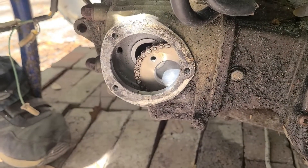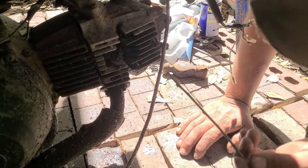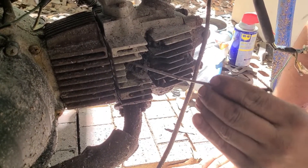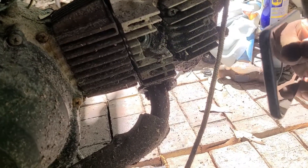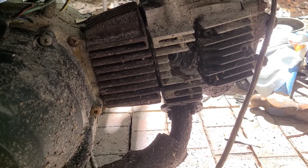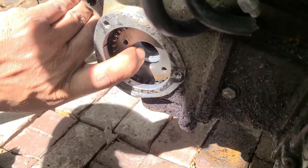We're going to see if the piston's at the top. Come over here and have a little stick — something that if it breaks off isn't really hurting anything. I'm going to stick it in this hole. I feel the top of the piston. Let's see if I can put a little light on it. I see the piston. So if that's the case, then we're off. Like you said, a tooth or two. We will work on getting that — it is off.